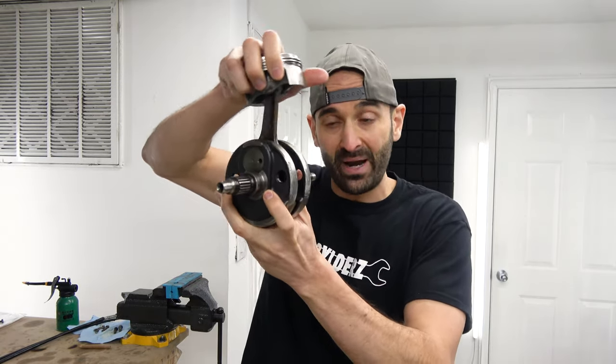So we know what the problem was on the engine. That rod bearing here is shot. It's super crunchy and it blocks. That's the reason why the engine was locked. So that's why I bought a brand new crankshaft in the engine rebuild kit that I'm gonna use to rebuild the engine. And that's gonna happen in the next video.